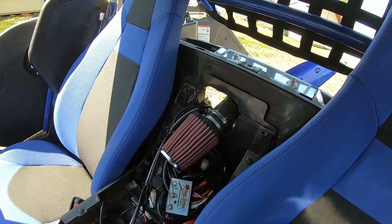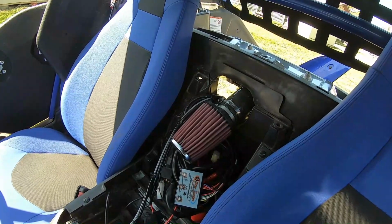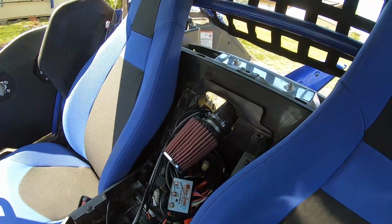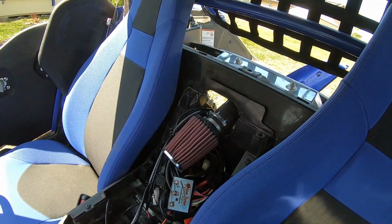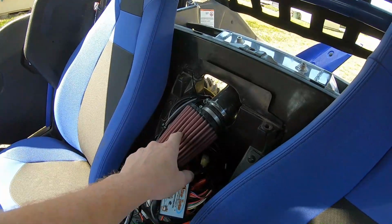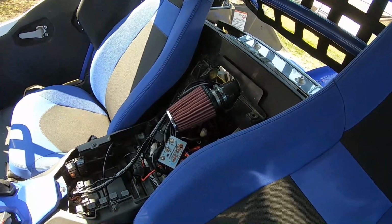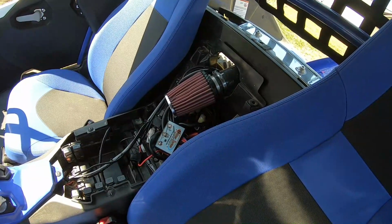And for me to reference this, sleds, snowmobiles, in the winter I used to build a lot of Thundercat 1000cc sleds, and a couple of them I used to run cone filters, like K&N cone filters like this style, on them, and they ran 38 mil carbs, which I bored out to 39.5. But I would run individual filters on each carb, and each carb had a filter pretty much the same size as this, and that was a 900 or 1000 running 3 of these. So to me it just seems kind of small for a 1000cc triple.